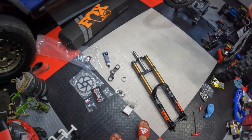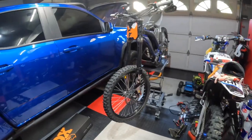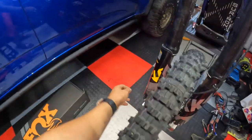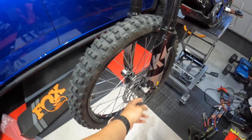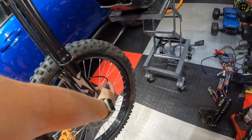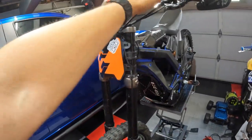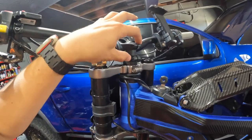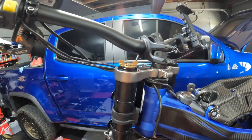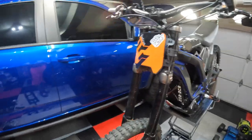To kick this video off, I'm going to tear essentially this whole thing off. I'll probably start with the wheel — take these two bolts off, the end caps for the axle, the pinch bolts, and then you should be able to slide it off. Disconnect your brake, then take off these two bolts, the bolt that goes straight down, and you should be able to pop off your bars, then take your clamp off. Let's get to it.